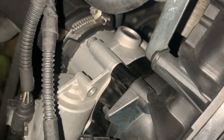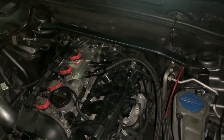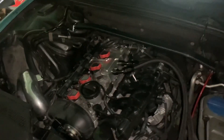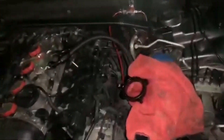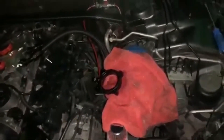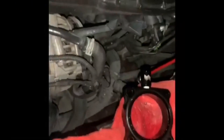To remove it, you unscrew the intercooler piping tubing — there's one bolt here, here, here, here, and one at the back right there — it comes right off. Make sure you get a real tight seal because I've made the mistake before of not sealing it properly and getting a boost leak, and I know a lot of other people have as well. Make sure you like and subscribe, share the video, everyone stay blessed. Right now, as you can see, this is my Snow Performance injector and this is my throttle body — I took the throttle body off to show you how the water methanol mist actually sprays through here.